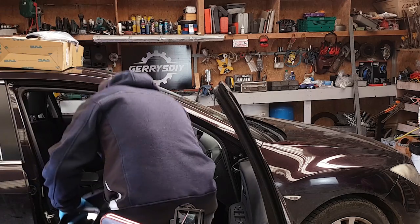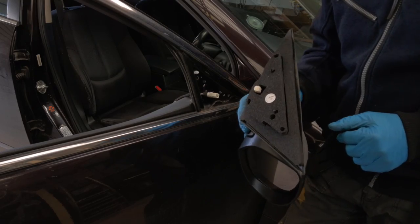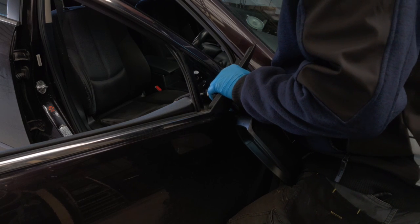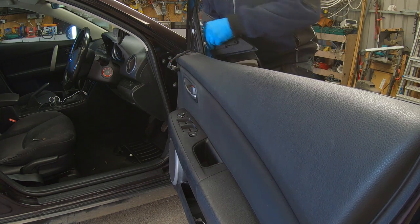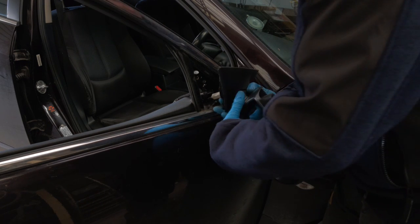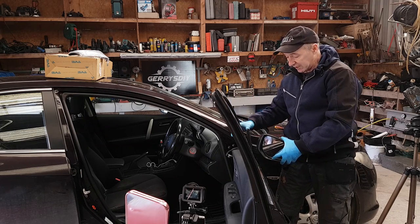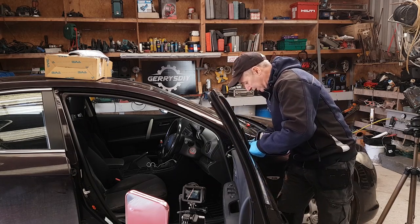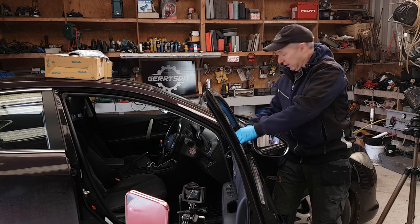This thing only takes a few minutes, so I'll grab one of the bolts and an 8mm ratchet. I'm gonna hook the wire up first — it only goes on one way so it's easy. Just line up your little tab in the socket. It does actually push in and click in as well. That's the little wire home. That plug containing the wires lives inside the mirror end rather than the car end, so I'm just locating it and pushing it back in. It's hard to see on camera but you'll know if you're doing it. Now just looking to locate the pins — a little bit fiddly to get the pins and wires to line up, but I've done that now.